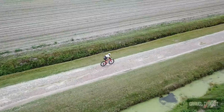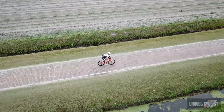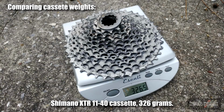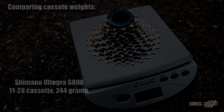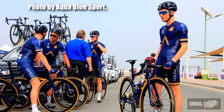In my opinion, this small amount of weight saved and claimed aerodynamic advantages just aren't worth the limitations of highly annoying gearing, especially when the front derailleurs in modern drivetrains shift so well. Why subject myself to annoying gaps on the cassette, where I felt the Strada was dictating my tempo with a 1x drivetrain and not the other way around, when I can have it all with 2 chainrings and a much tighter cassette? I know that the earlier mentioned European Pro team were greatly displeased with the huge gaps in their cassettes, so I'm not alone in thinking this.